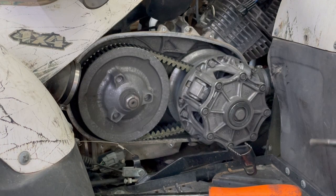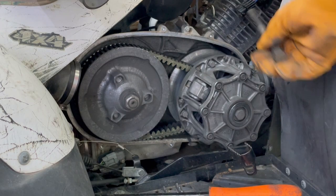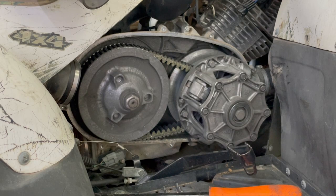I've got a puller — I can show you a puller here. Here's a puller that you'd use on it. You just take out this bolt here and it's reverse thread — like if you tighten a normal bolt, you would loosen it. Put it in there and tighten that up and it pops loose, and this whole primary clutch pops off. But why do all that when you can do it the easy way? Especially if you're out in the middle of nowhere and you have a flat spot in your belt or your belt breaks or something.